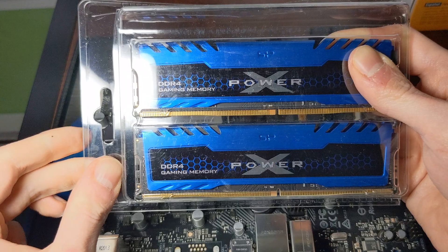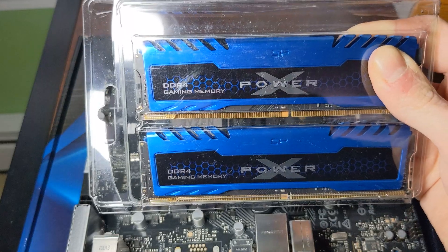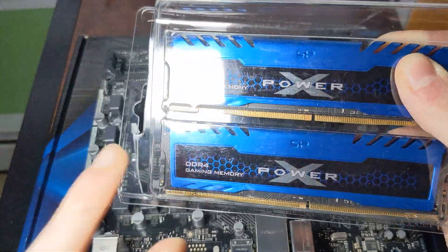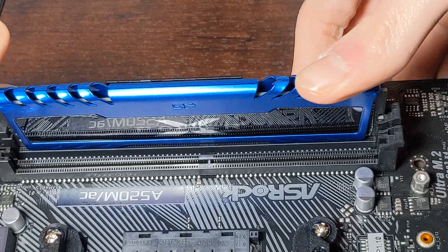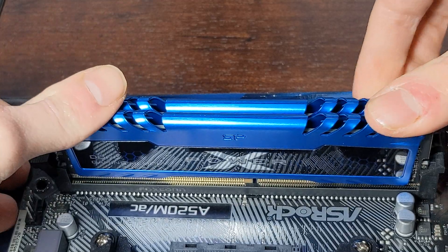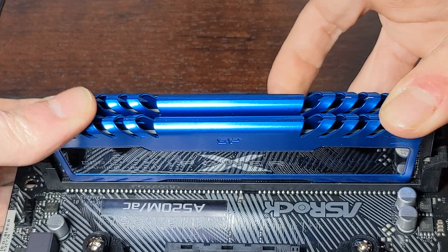Here's the RAM. DDR4 is faster and cheaper than the last time I did a build — the last one used 2,400 MHz, this is 3,600. 16GB is necessary for some games to run so I definitely recommend getting it. This was only $69. This motherboard only has two slots. You need to be aware of which channels are ideal when you aren't using all four, and also the RAM speeds your CPU and chipset are capable of. The advantage of doing the RAM before the CPU cooler is that some CPU coolers are huge and cover the RAM slots.